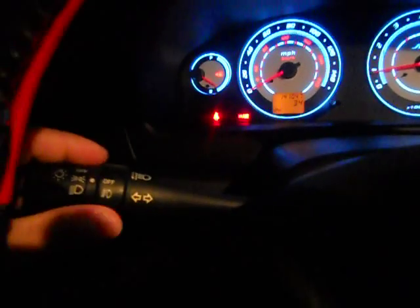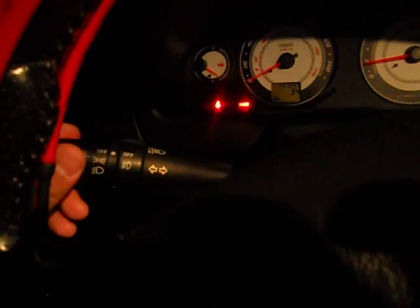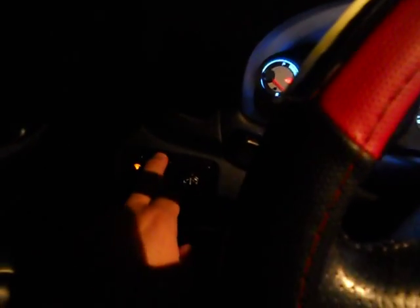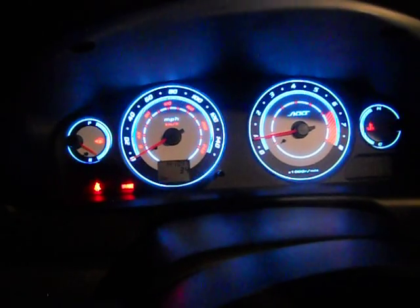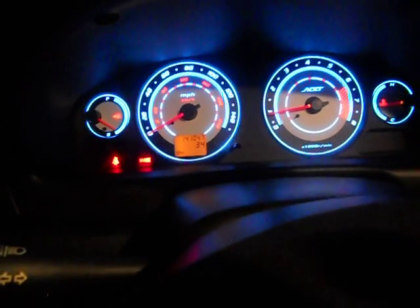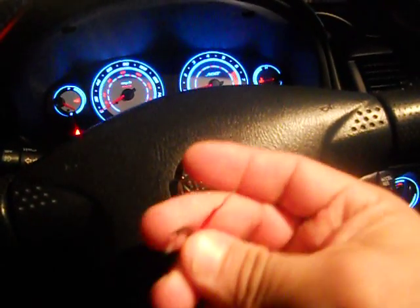And the way you can see that, it is controlled by this switch here. On the off position, you have no voltage. On the on position, you should have 12 volts here. And the wire in the middle, that's the dimmer for the gauges, for the needles and the other stuff. Don't use that one. Just use the 2 on the sides. So I cut my black one, terminated black with black and red with red, and put tape on it.